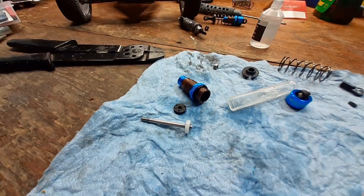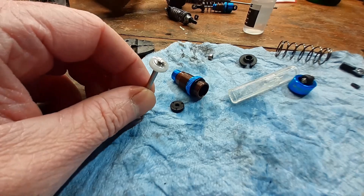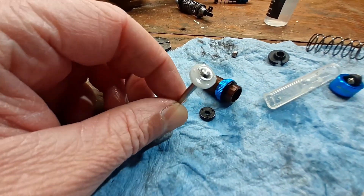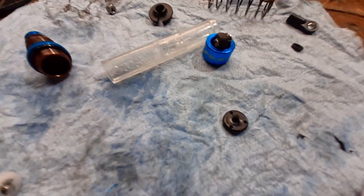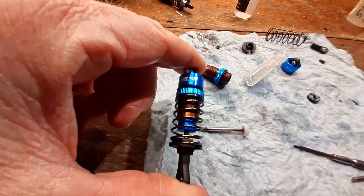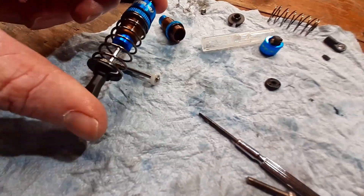It's cold out right now but these shocks seem really, really stiff. The pistons on here have two small, really tiny holes in them, so I'm going to use these Traxxas three-hole pistons. They worked really well - they're a little bit smoother and surprisingly they fit perfect into these shocks. So if you have some of these shocks, you at least have options to kind of tune them.